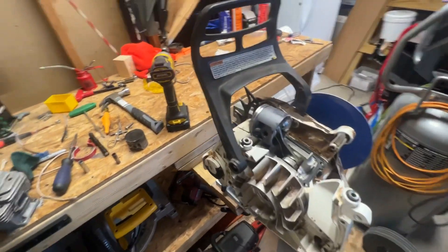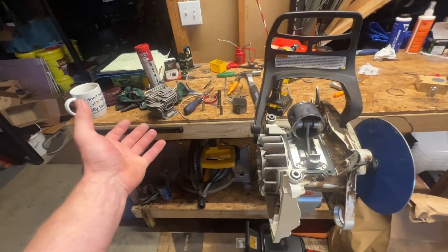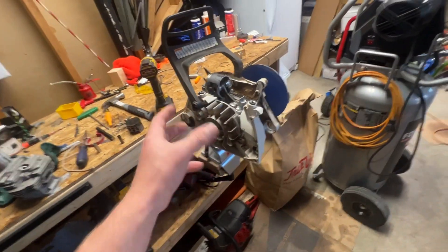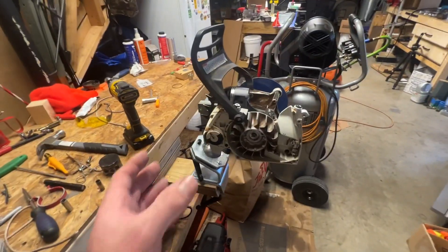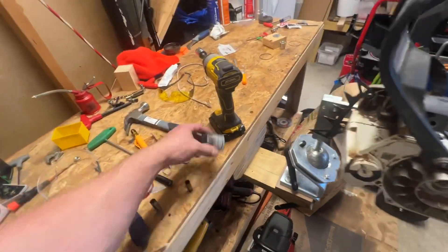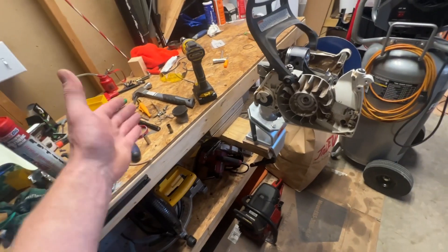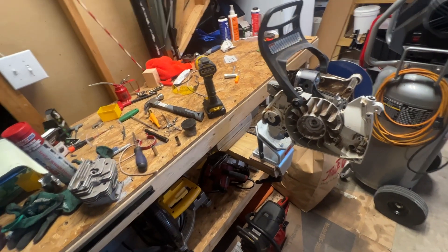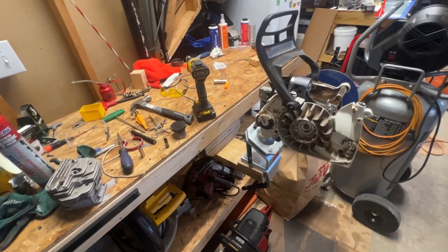The other nice thing about this piston is I feel it's better suited for this style of build by the way the transfers are designed — it kind of more resembles a 500i as far as piston design. I'm hoping this will make considerably more power than just doing a basic port job, because you are limited with the exhaust port width. The builds where I've been able to hit 65% of the bore seem to make the most power.